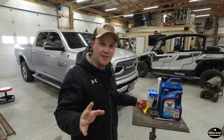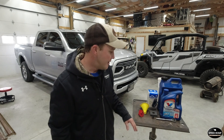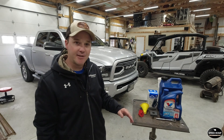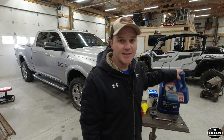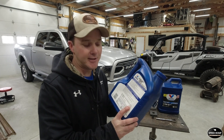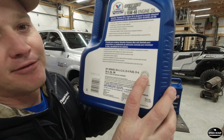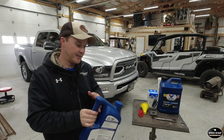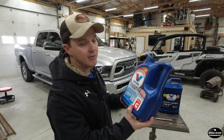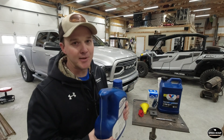All you're going to need for this service — look in your owner's manual. My truck calls for CJ-4 15W-40 oil above zero degrees Fahrenheit; if you're going to be operating below that, my truck calls for 5W-40. My truck calls for the CJ-4 API diesel oil specification, which you can see by the API oil donut on the back. This oil is CJ-4 and CK-4 — I think the newer Cummins call for CK-4, and this oil meets the requirements of both. I'm going to be using Valvoline Premium Blue 15W-40. Use whatever you want, but look in your manual and make sure you're meeting your manufacturer's recommendations so you don't mess up your warranty.